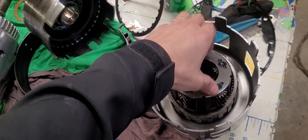So as you can see, it does kind of work out sometimes. I just went on Marketplace, looked for a 4L65 — preferably one that was damaged or burned up, just a rebuildable core — and took the gamble if I could get one cheap enough to pull these parts out of. Ended up working out pretty good. I paid $100 for a $700 planetary set. You can find these online used for around $330–$350, which isn't terrible, but this works out much better. I also ended up with another pump, another input shaft with the drum, and these ones are actually heat treated — so they're the better ones since it's a 4L65.